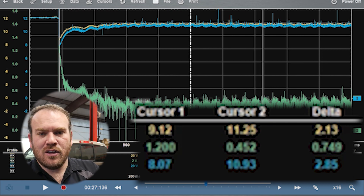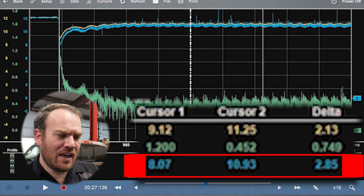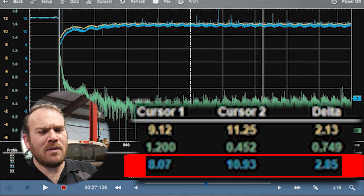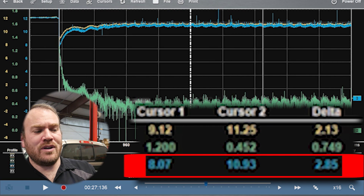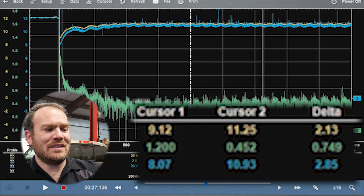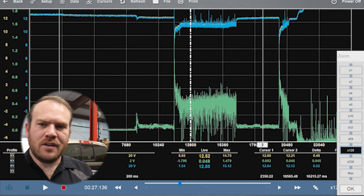On the positive side we still have some issues — more than I expected. I haven't had to replace a positive cable in one of these before. My clamp is on the terminal end on the end of the cable rather than the stud of the starter. Most of the resistance is going to be in the cables at the battery — they went to a different design where they crimp on the battery cable end, and that end up getting corrosion in there. There's not really anything you can do to fix it; it's easier just to replace the cable. The dealership actually had the negative cable sitting on the shelf.